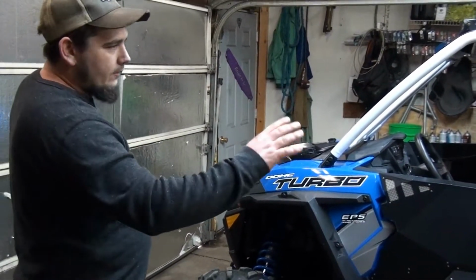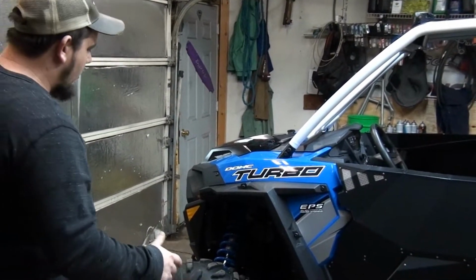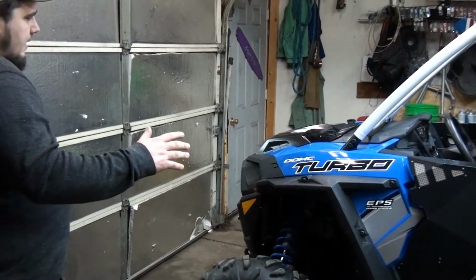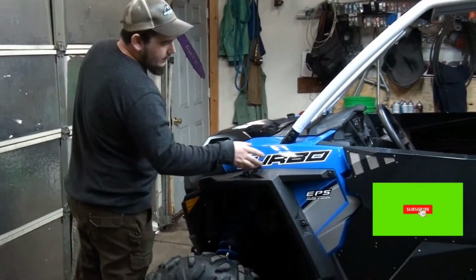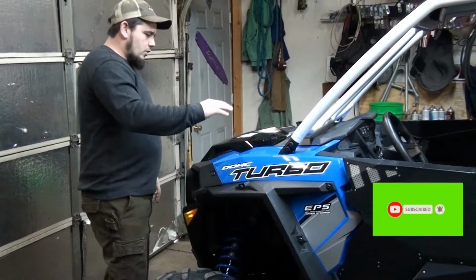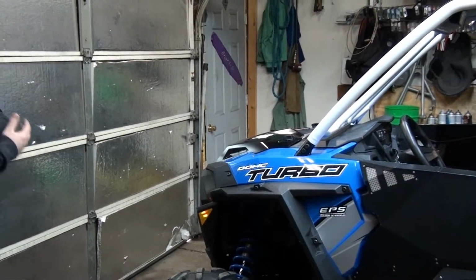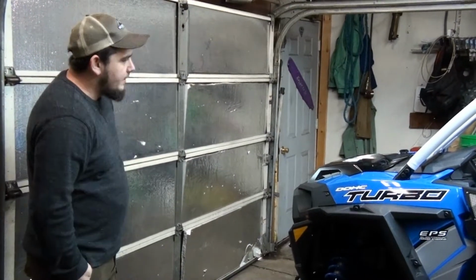So all the stickers have to come off. Everything's gotta get wiped down 5 or 6 times with rubbing alcohol. Once you get that done, you can start putting a wrap on. All the wrap is all individual pieces. So every different shape or body line, the way the different body lines move, there's nothing really folding over. I think it's going to be nice.